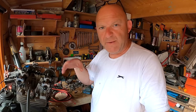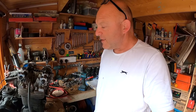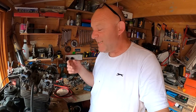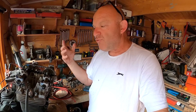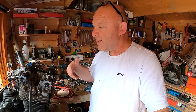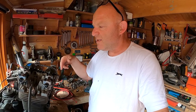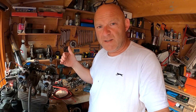So it's going to have to all come apart, I'm afraid. It's not what I really wanted to do, but those are the breaks. The point of this video really is to make sure that you've got a reasonable engine before you start sticking it in a frame. Make sure it's all turning over, take the time to check your valve clearances, but also your compression on all your cylinders as well.